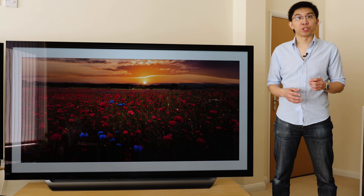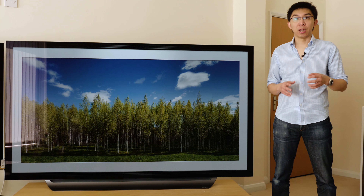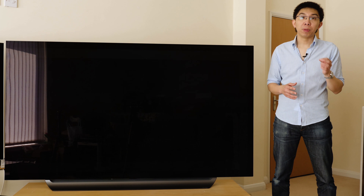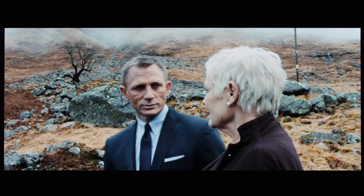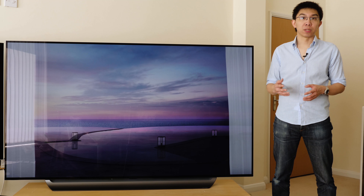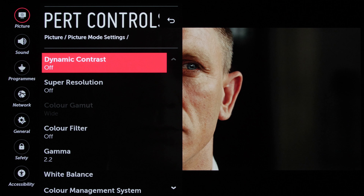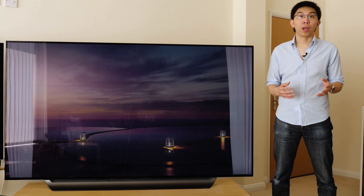Using the traditional manual calibration method — namely 2-point and 20-point white balance controls — I achieved excellent SDR colour accuracy on our 77-inch C8 review sample, with none of the measured colour patches in the ColorChecker SG chart exceeding the humanly perceptible threshold of Delta Error 3, meaning memory colours such as skin tones and foliage will look extremely realistic. The LG C8 features 3D LUT auto-calibration functionality, but after intensive testing, I won't be using it when calibrating professionally for home customers. Once a picture mode has been auto-calibrated using the 3D LUT, the colour gamut, gamma and white balance controls are all locked across all source inputs, and currently there is no way to back them up.